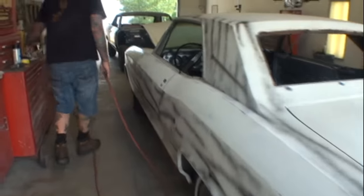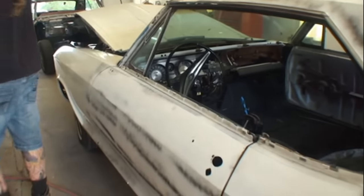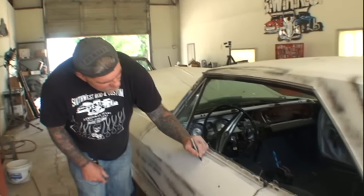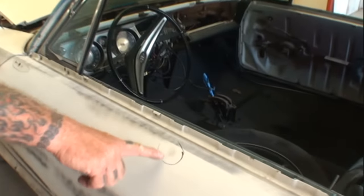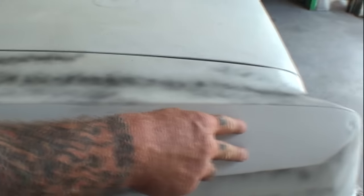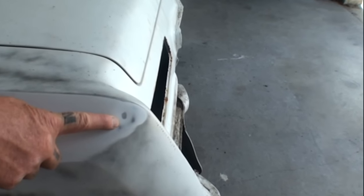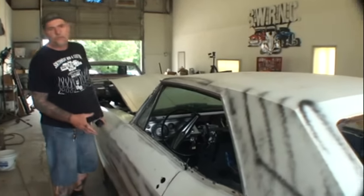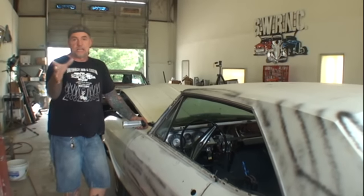Okay, if John can bring the camera over here, I'm going to show you the imperfections we found. Without using the light and now using a guide coat — what we found by guide coating and then sanding — we got a dent right here. Can you see the difference in color? And then over here, you can see there are chips in the paint. Moving down, it looks clean until we get into this area — look what we got right here. Do you see that round circle? That's a dent. So we've now identified dents clearly. I told you before I sprayed that I didn't wash the car — and the reason is that if the paint misses a dent, the dirt will catch it.